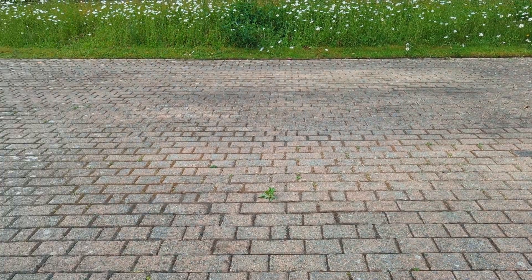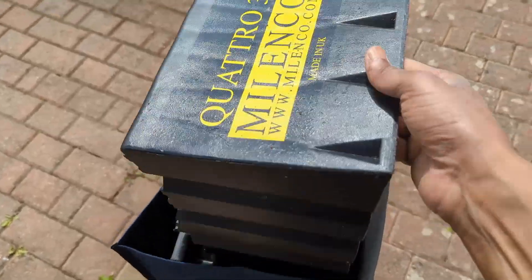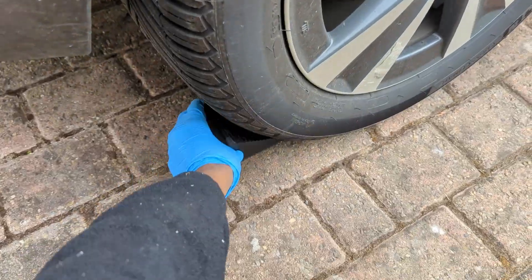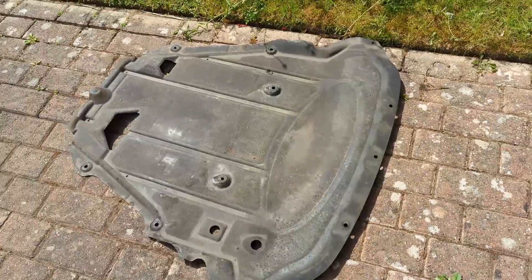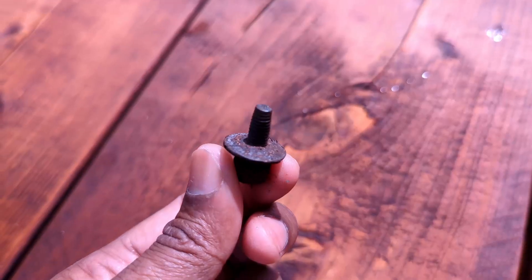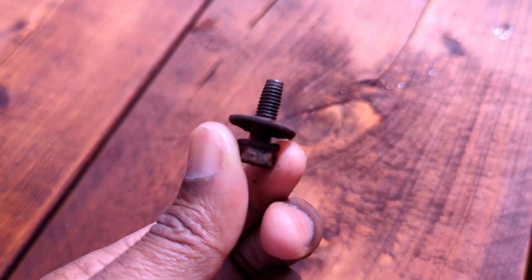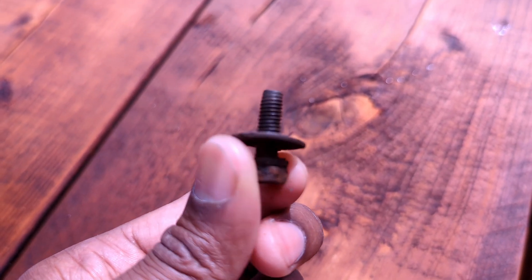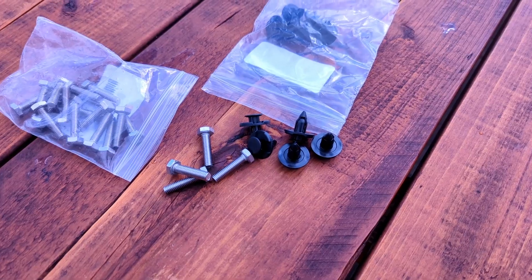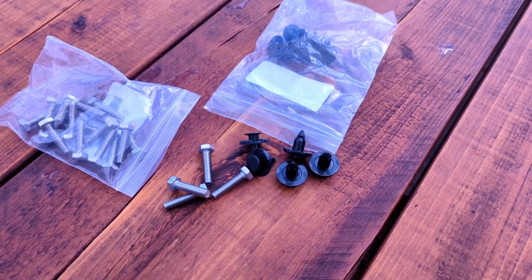It's important that your car is levelled to drain the oil out. My driveway is on a slight incline, so I'm going to have the car up on a couple of Malenko ramps to get it levelled. Remember to use some wheel chocks. To get started, you'll need to remove the splash shield. This is arguably one of the most tricky bits of this job, as the 10mm bolts on the front commonly rust and can snap whilst you're trying to get them off. So do take your time — it's always sensible to have some spare bolts and plastic clips to replace any that break.